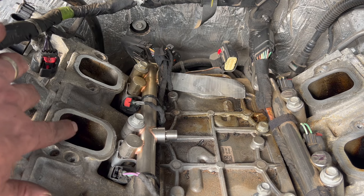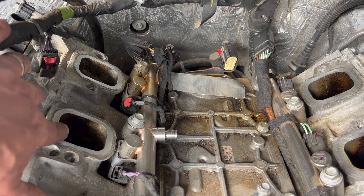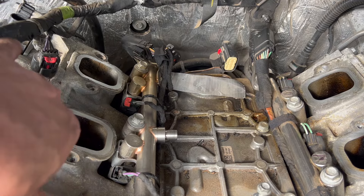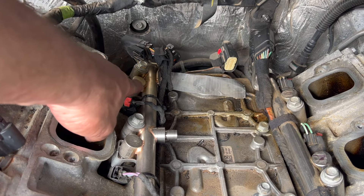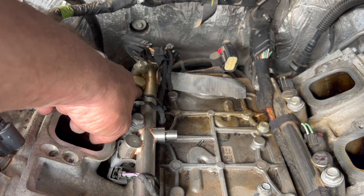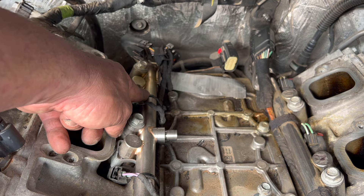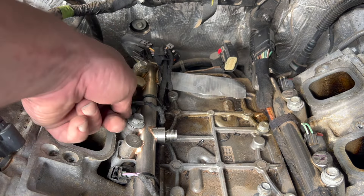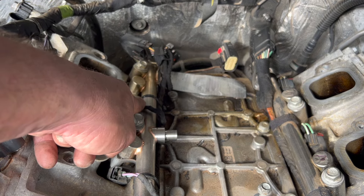Definitely want to close off that opening once the pump is out so nothing falls into it. A lot of people would cover the intake — I would recommend it. Mine is going to engineering so they'll clean the heads completely. However if you don't take your heads to engineering, cover it up so no dust gets in when you take off the valley cover. By the looks of it, one injector at the back appears to have been leaking — I'll figure it out when I take the fuel rails off. I always did have a smell of gas after the truck was at an auto shop for injector replacement, so yeah, let's just leave it at that.